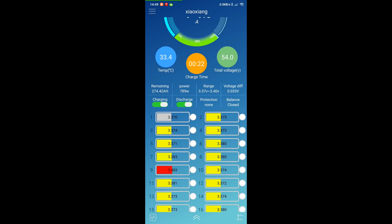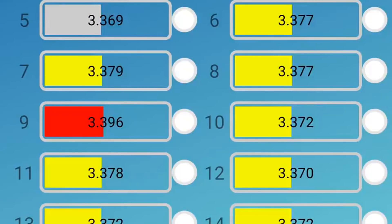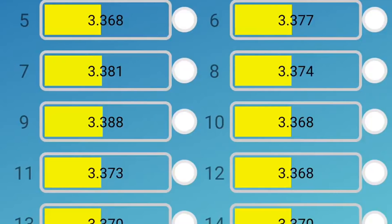Let me start the screen recorder. There's the positive terminal — just loosen it a tiny bit. Negative terminal as well, just enough so I can move the battery around. There — see, it's already fixed, it's green! Look at this — there is oxidation under the terminals, under the bus bars. Okay, five newton meters, and we torque it up with the torque wrench. There we go — and here the positive as well. Five newton meters. All right, that is fixed.